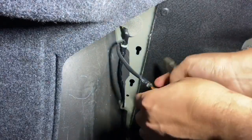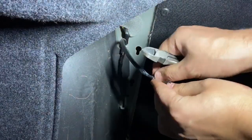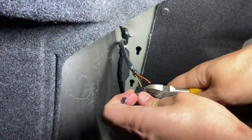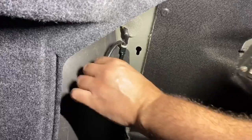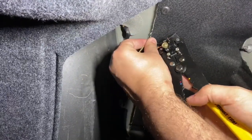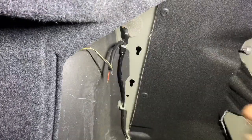As you can see, it has three wires: black for ground, red with a yellow trace which is fed by Fuse 23, and yellow with a blue trace that connects to the iBus. I cut the three wires at different lengths so the splice connectors are not at the same location, which would make the harness thick and could short things out in case of multiple splice failure.